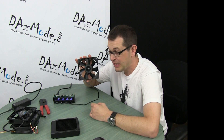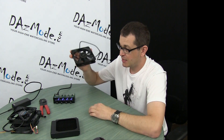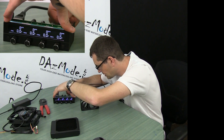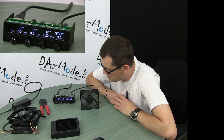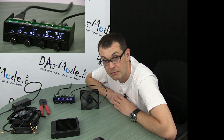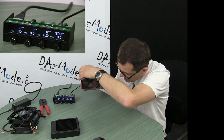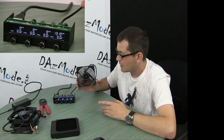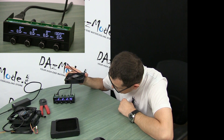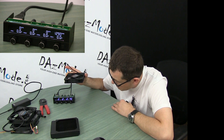Let's start with the slowest fan — the 1200 rated RPM XSPC cheap fan, probably costs a dollar to make. It's a sleeve bearing type. Let's simply connect it and see what we're getting. Wow, we have 1310 RPM, which is better than the specs — a little bonus! So next, I put it so that air is pushed up and see what happens. Basically pretty much the same, with a very minor change.